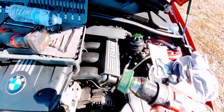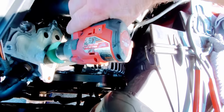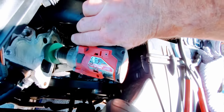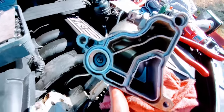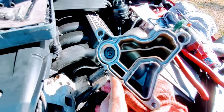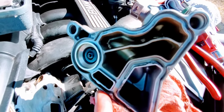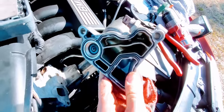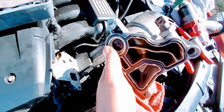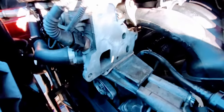We're using a Milwaukee tool with a scrubber — a gentle one for aluminum. Get in there at nice low speed with no pressure, don't push on it at all, be gentle on the trigger. Do the best job you can without pushing too hard. Once all the residue and tiny particles are cleared — fortunately my gasket came out nice and smooth. Very important: nothing falls down into the cooling chamber, otherwise you invite different problems.